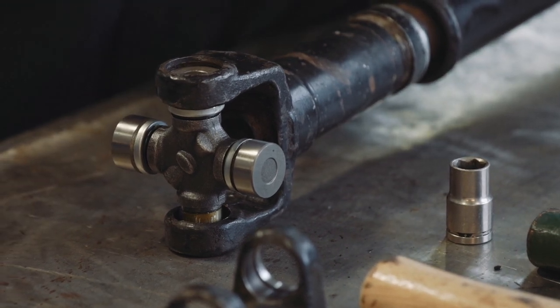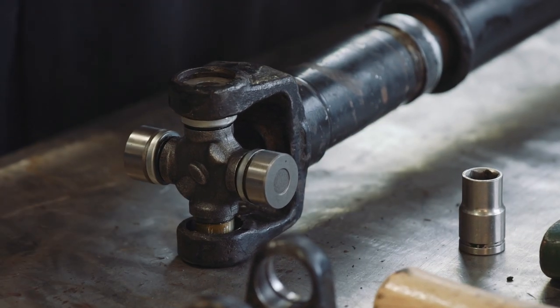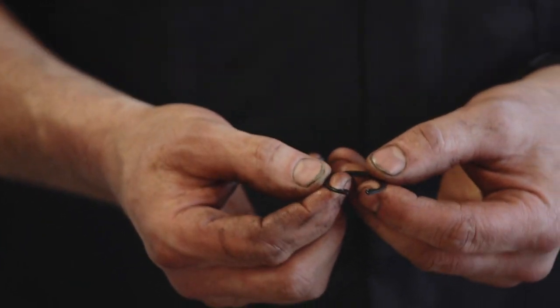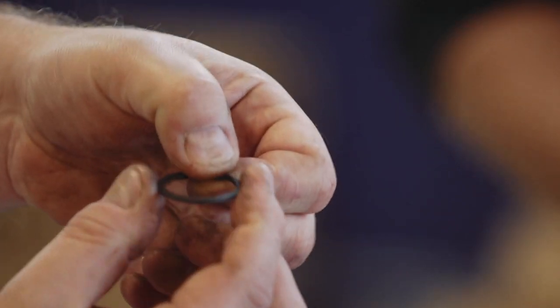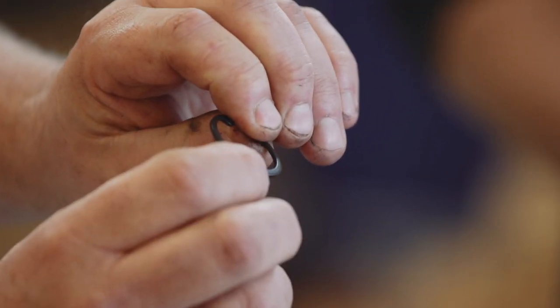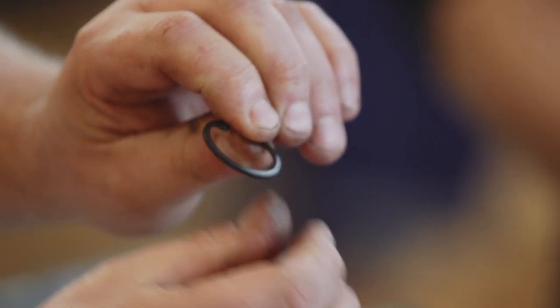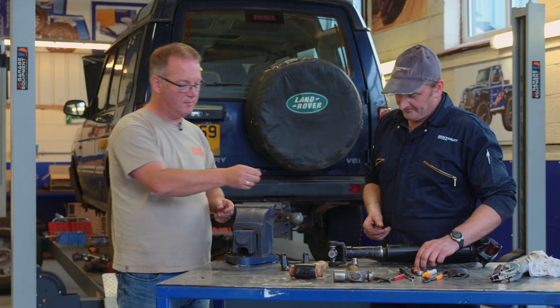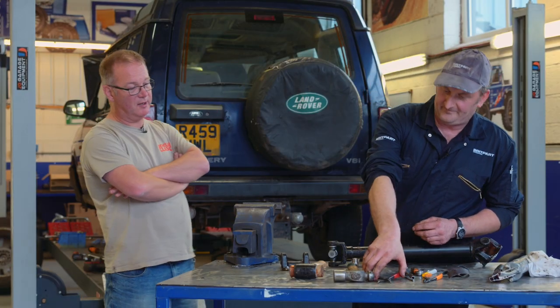Is there any way round you need to put the circlips? Yes, there is. The circlip has a rounded edge to one side and a machined flat edge to the other. The machined edge needs to be facing outwards so it grips into the groove — it stops it coming out in operation. I never realised that before, so that's a tip for me.